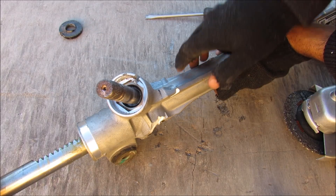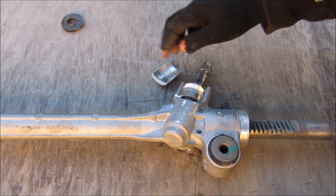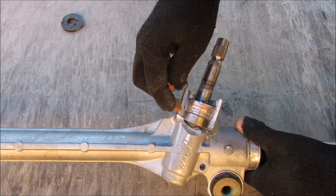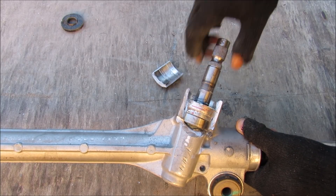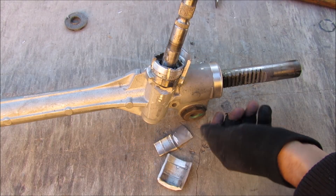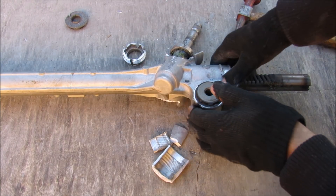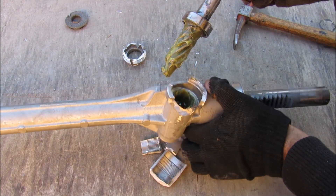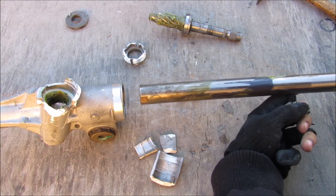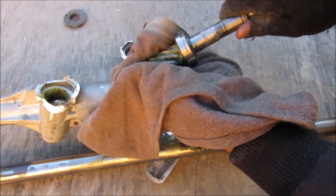With that slit in there I'm going to peel out this top seal — just a piece of plastic — and that reveals an internal hex. Chopping off a cross section shows threads for this internal hex bolt, and underneath the hex bolt there's also a spacer. I'm going to chop the rest of this sleeve off to get the input shaft out. With the threaded nut removed, the input shaft can be removed and I can clean up the grease.